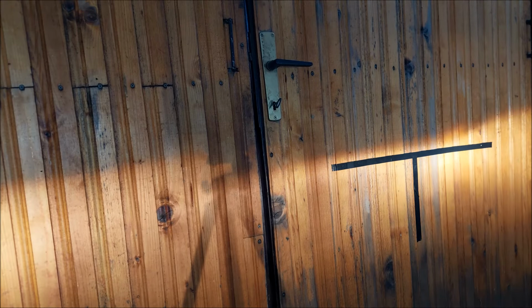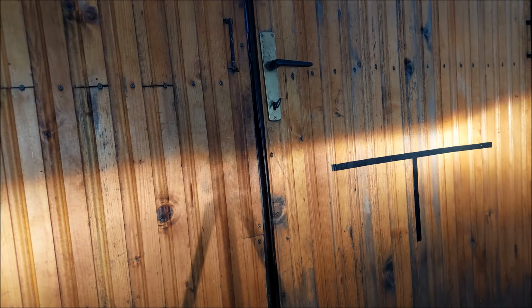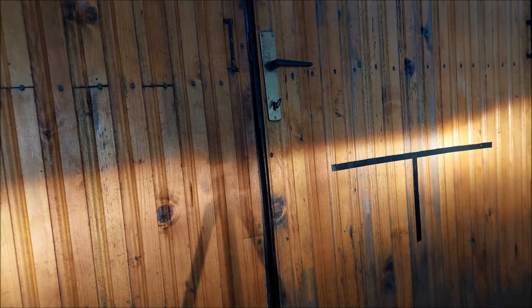And as you can see, as I'm turning that little screw clockwise, the low beam is moving up. So that first screw is gonna be in charge of moving the low beam light up and down. The clockwise motion is gonna move it up, and the counterclockwise motion is gonna move it down. Since everything is good with the low beam lights, I'm not gonna mess with it. I'm just gonna put everything back as it was.